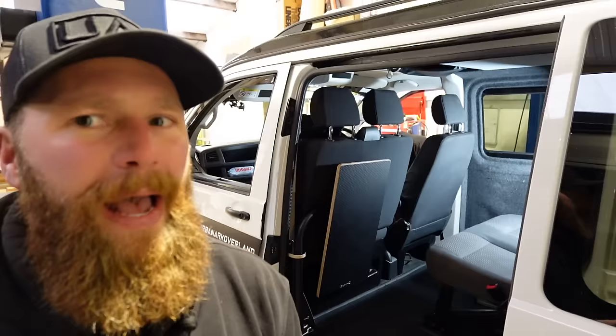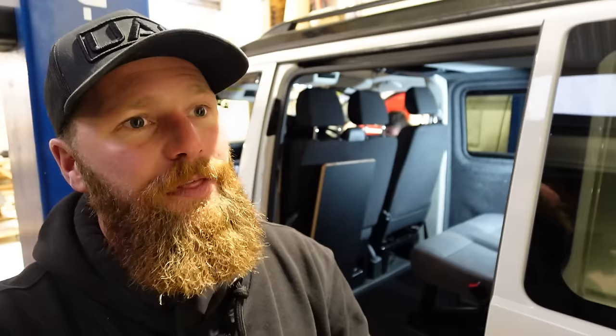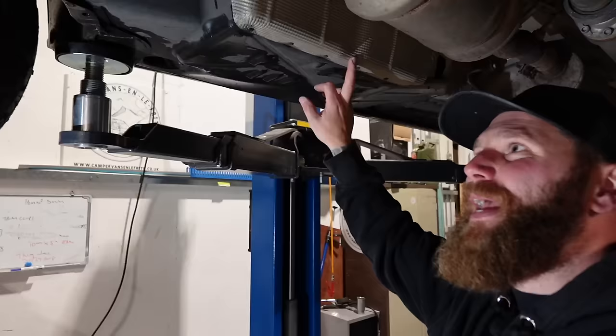Adam is removing the driver's seat - it's four bolts, one in each corner. I'm not going to show every single nut and bolt, as the video would become too long. If there's something difficult or unusual I will explain further. The seat is out and we're now going to remove the under trays from both sides of the vehicle.